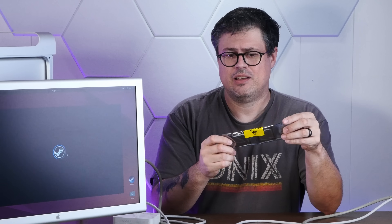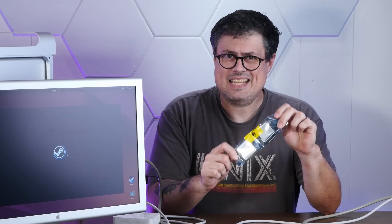I'm quite pleased with this so far. We have an extremely upgraded Mac Pro 5,1 booting Linux off of NVMe, an RTX 2070 Super wired internally so you can actually put the case back together without weird wires sticking out — which might be a first for this channel. This thing has 96 gigs of RAM in a triple-channel configuration that's giving it quite a performance boost. But there's still one more thing we have to do, and I'm honestly a little scared of it: we're going to swap in two new matched Xeon X5690s. We have to de-lid them to work in this older 4,1 chassis, which has a different heatsink configuration than these were intended for, so I'm going to save that for the next episode.